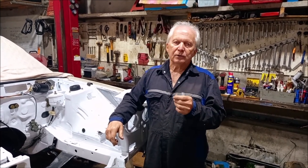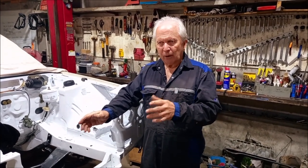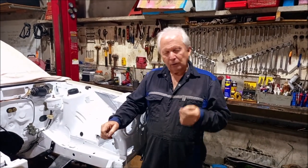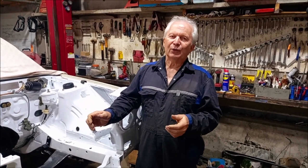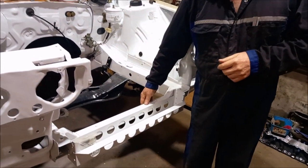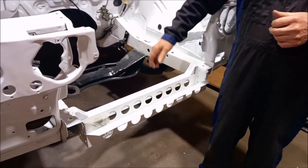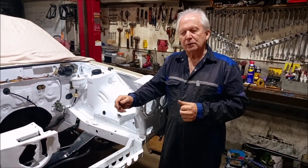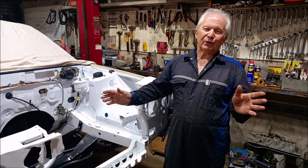When you scroll down and find the LH section and read through it, it even tells you what thickness of material you're supposed to use — and bigger is not always better. I saw photos on a forum of a panel that looked like it was made out of six millimetre plate. That's actually overkill and not within the rules. The rules say you can't go more than two and a half times the original thickness. The bar supporting the radius rod brackets is three millimetre wall thickness, which matches the original crossmember. So yes, you can cut it and put in a new radiator support panel.